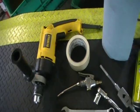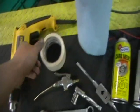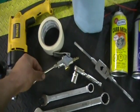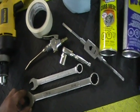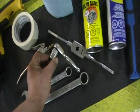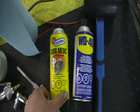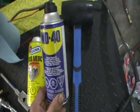Here's what you're going to need to supply to install the stud kit: a good half-inch drive electric drill, a roll of masking tape, an air blower attachment for your compressed air supply — preferably with an extension to get to the bottom of the bolt holes — an 11/16ths wrench, a 15/16ths wrench, a ratchet with an 11/16ths socket or another wrench, a tap handle, and a can of carburetor cleaner or brake parts cleaner — both work very well — and a can of penetrating lubricant like WD-40.